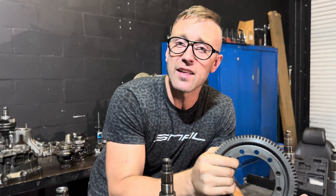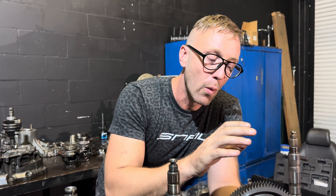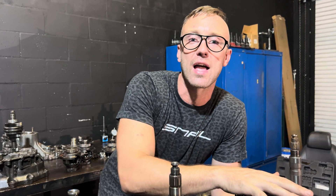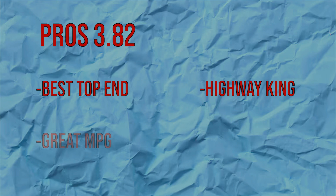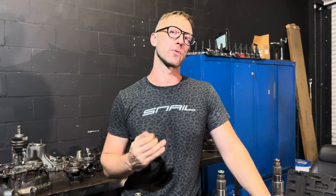The 3.82 is a little easier to find than the 4.45 but not quite as easy as the 4.05. If you're more of a highway cruiser, or really want to ease into the throttle and deal with turbo lag, the 3.82 definitely makes the most sense. Pros: amazing top end, great for highway pulls, best fuel economy, and if you're looking to make 350 to 400 brake horsepower it is the perfect final drive.